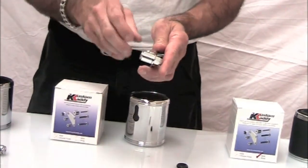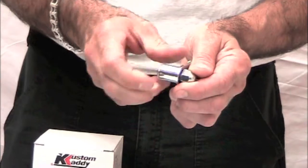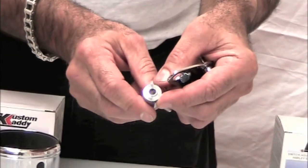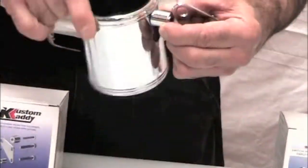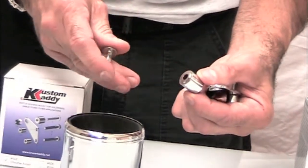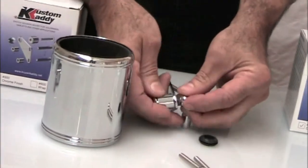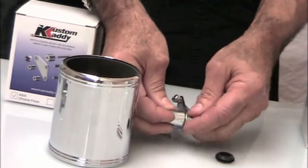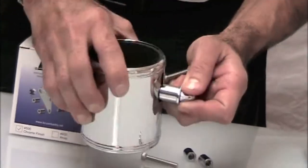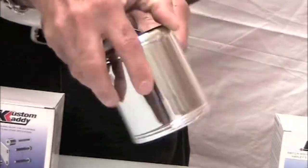Once that's installed, there's a spacer and holder for the cup holder itself. The cup holder has a keyhole slot in the back, and the back of the spacer has got two ends to it — an oval or slotted end, and a round end. With the round end installed, it allows the cup to pivot or swivel 360 degrees. That may be good on a passenger armrest that pivots up and down, but most of the time for the driver we're going to want to use the oval end, which prevents the cup holder from rotating in a circle so that a tall bottle of water doesn't turn upside down and dump your drink out on the street. So we assemble that with the oval end by the head of the screw — that fits into the keyhole — and when tightened down, that's what keeps your cup holder from spinning around in a circle and keeps it nice and straight.